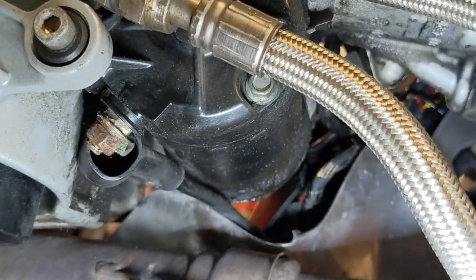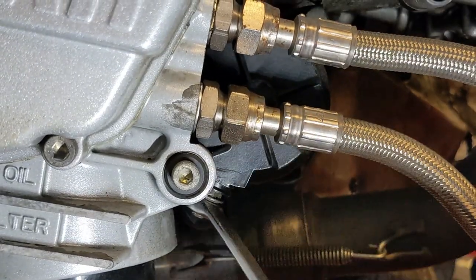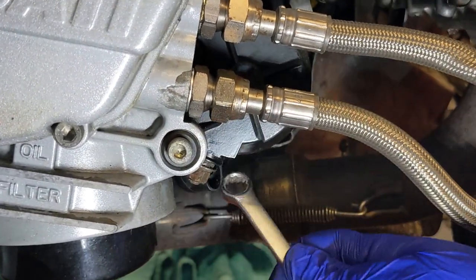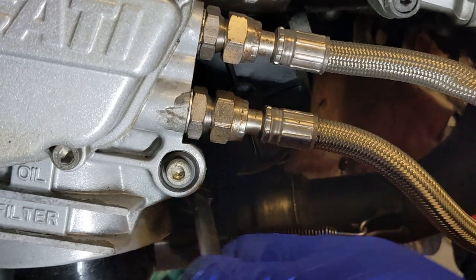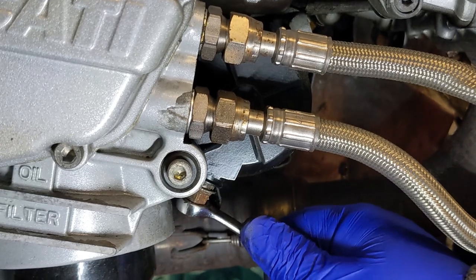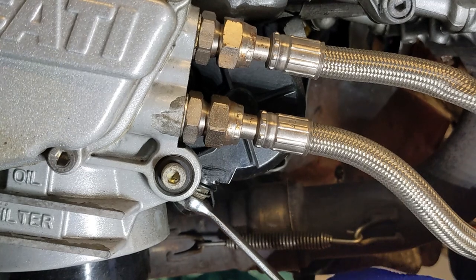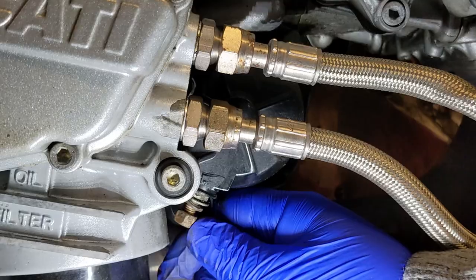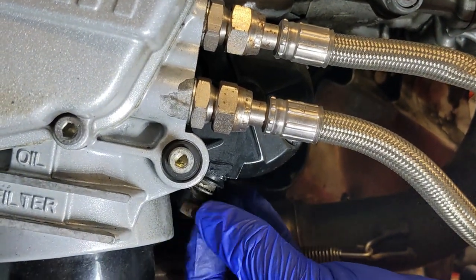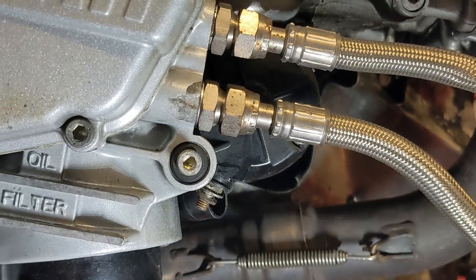You can see there's some corrosion on it. So it's a 10mm and I'd suggest you use a spanner on it — lefty-loosey. Don't mess around with something like this because all that's going to happen is you're going to end up needing a starter motor. So nice, clean movements, and try not to apply too much pressure with the spanner up and down. Look at that — that's the nut.